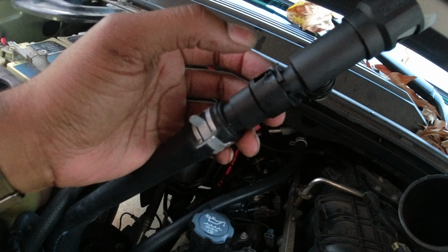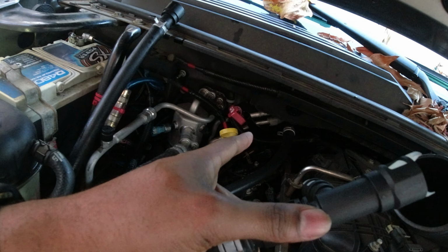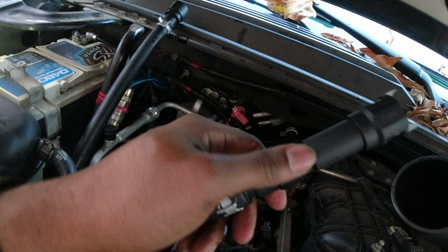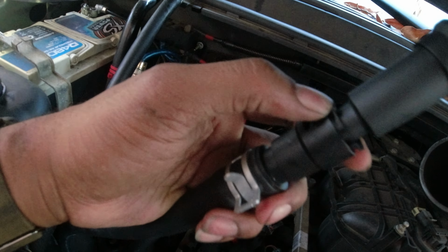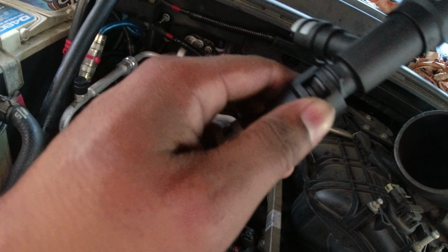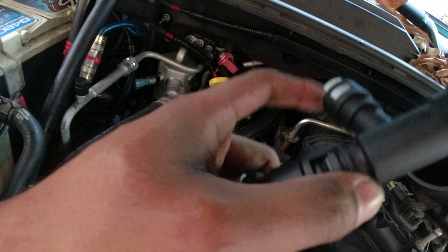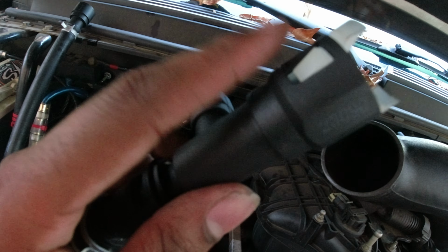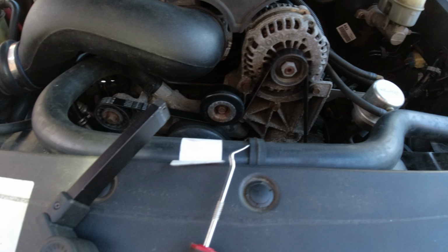Now, word to the wise, connect the coolant line, the heater hose, up to the adapter before you attach the adapter to the auxiliary and the heater core, because it takes a good amount of force to get that to seat, and it has to be in a very specific position. And I just don't feel right pushing it on the firewall, like something else is going to break. So clip it on here and then attach the auxiliary bottom hose and then to the heater core in the firewall. Everything's hooked up, put back together, hopefully tight enough, hopefully everything is clamped down.